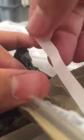And this is a little tricky part. You do not want to bend this wire. It's very important, especially from here. It could curve a little bit, but you cannot bend it like a right angle or something. It will screw up your controller. Trust me, it's happened to me, and I've had to get new controllers. Well, actually, thanks to that controller, I learned how to take apart controllers.